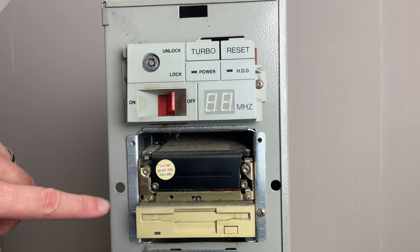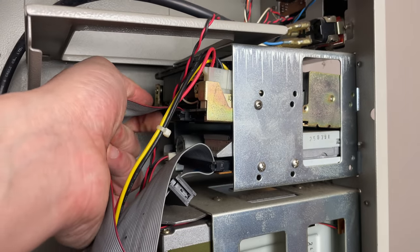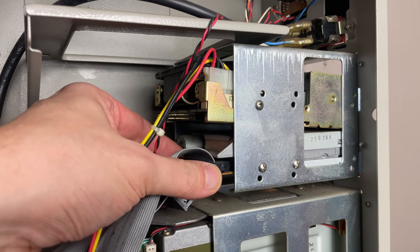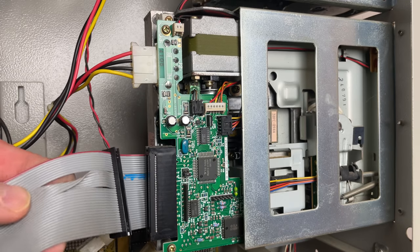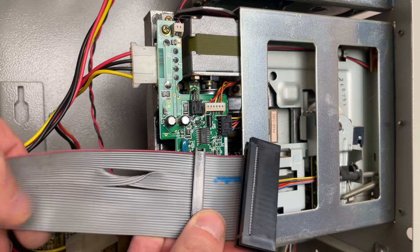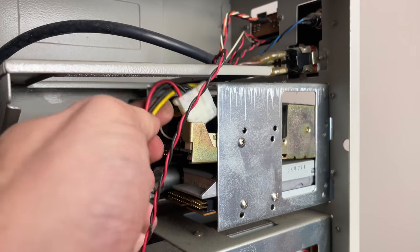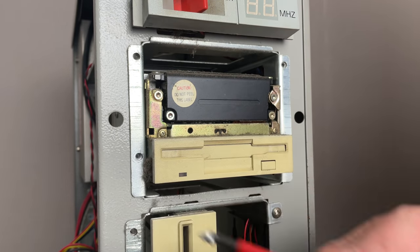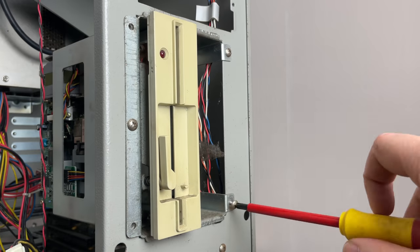To access the drives we need to open the front cover, as the side panel is the only panel that can be removed. The drives are held in place with a caddy system, so you need to get the screws off from the front of the case. Both the control unit with all the buttons and LEDs, as well as the hard drive and disc drives, are attached to this front panel. Removing cables for the hard drive and the two floppy drives: the 3.5-inch drive doesn't use the twisted part of the cable so it's designated drive B, but the 5.25-inch one does have the twisted pair so it's configured as drive A. Not only do you have to configure them properly in the BIOS - the cabling also needs to be set up correctly.